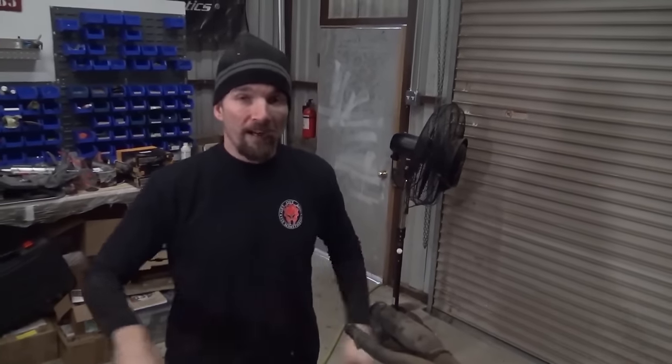Now, modern fuel tanks do not have any drains on them at all, and I'll explain why in a minute. Since it doesn't have a drain, the bottom just keeps filling up full of water, and wherever you have water in a warm, moist environment, you can have bacteria, and that's where that algae comes from. So the diesel fuel doesn't actually breed algae, it's the moisture in the bottom layer of the tank.